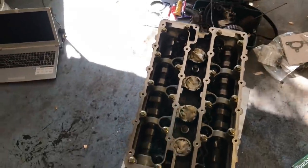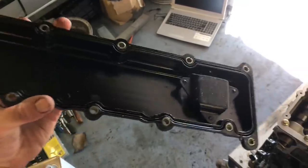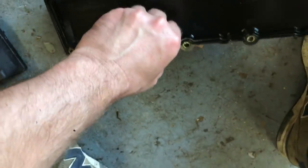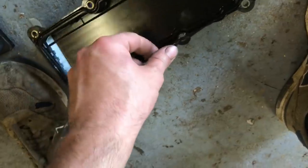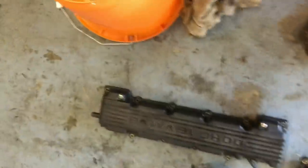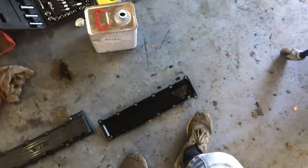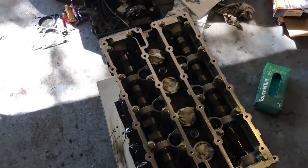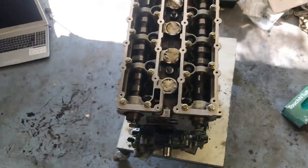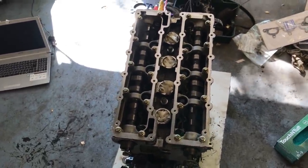Cleaned the cams up because there was a tiny bit of dust on them. I'm going to reinstall the cam covers. The old seals are really horribly stiff and hard — they are the original ones. It's got nice new flexible soft ones to go on, and then just a whole load of M6 bolts to go back in. I was going to buy one of those stainless steel bling kits, but I actually quite like the look of the black ones, so I'll stay original.